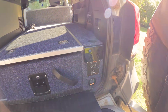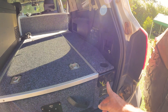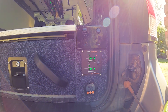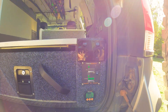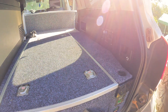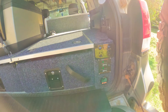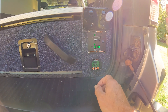Off the end of that we've got two extension cords plugged in, just wired into these PowerPoints — easy to use. You flick that switch. Before we get into flicking the switch, you need to make sure you can turn your remote inverter switch on — that was the last little thing we did. Which means when we've got the back full of gear, as you can imagine living out of the car, we would have had to pull the opening off to get to the inverter and turn it on. So that little remote switch has come in super handy. At the moment we're sucking out 0.8 of an amp with the switch turned on.